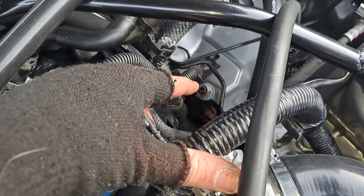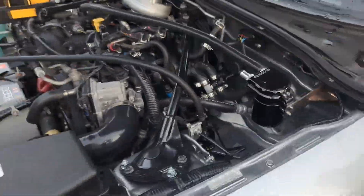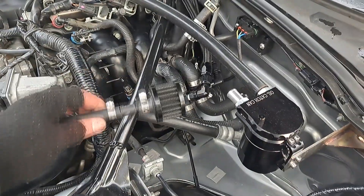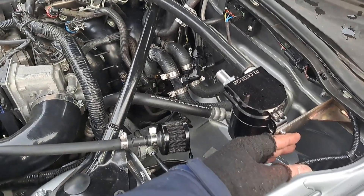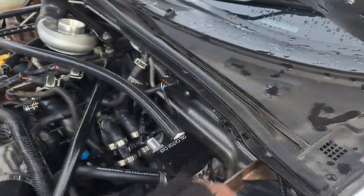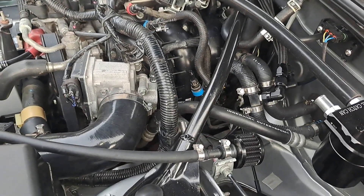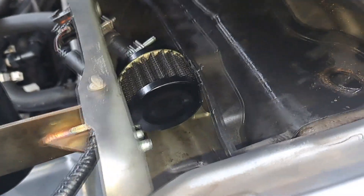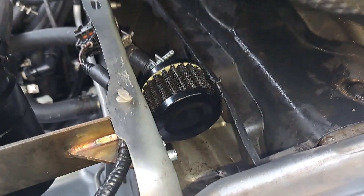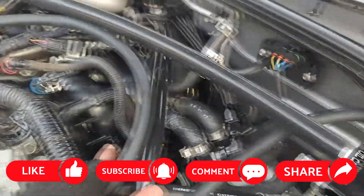The other end of the purge valve is connected to a charcoal canister, so this is obviously fuel-related. I want to vent this to atmosphere — I could vent it into a corner of the engine bay, but it'd be nice to vent it outside to avoid fuel vapors in the engine compartment. I've been able to just wedge it between the bulkhead and the plastic piece — it's wedged really solidly there with no banging — so that's a good vent to the outside. I'm then just feeding it through the brake area.